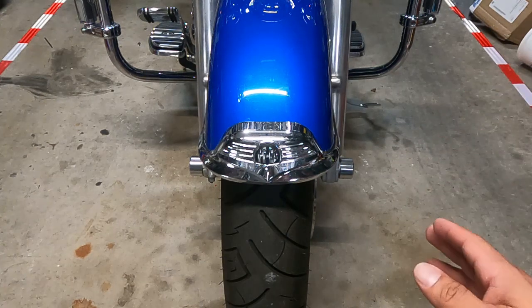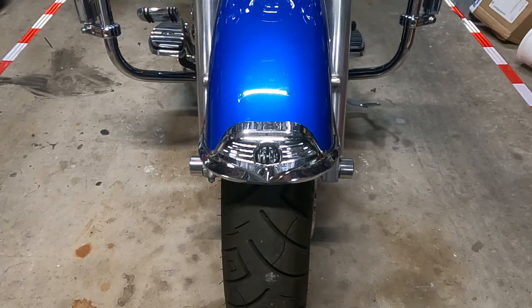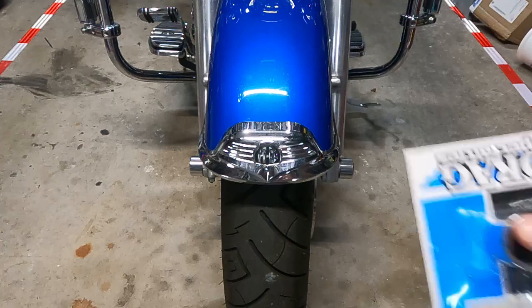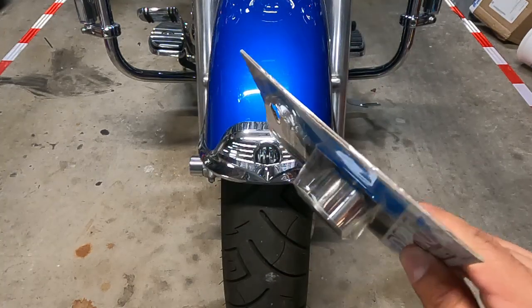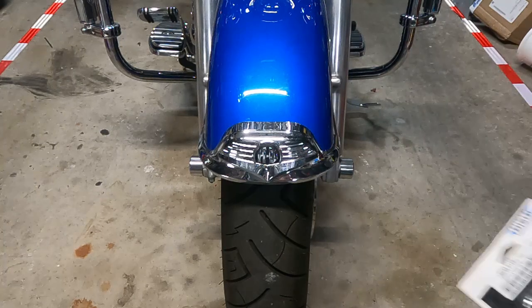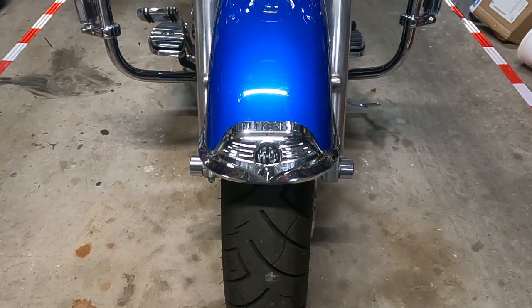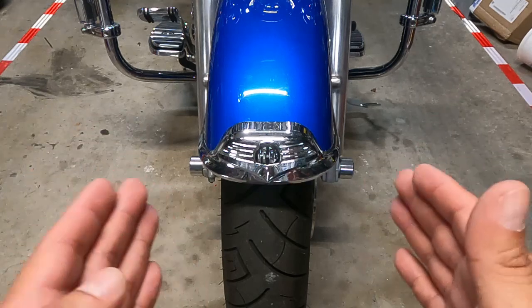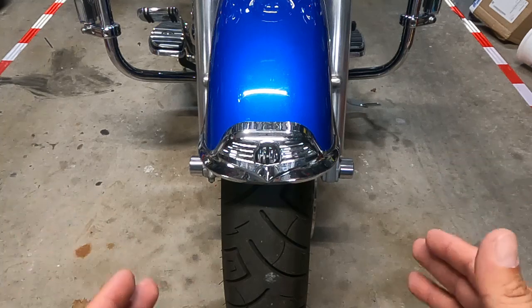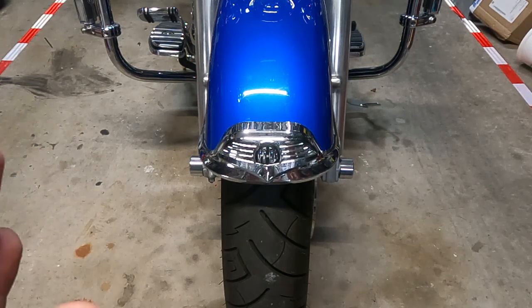What we've done is temporarily put a fix in place, which was to add some very thin carbon washers to accommodate for that extra space. We're going to replace those along with that spacer with a Drag Specialties 25-millimeter or one-inch axle spacer. I've got those spacers in place so everything lines up right now, but I'll take those shims out and put it back together roughly to show you what it looks like when things aren't lining up. As we do this, also keep in mind that you want to keep things centered — you don't want things shifted one way or the other.